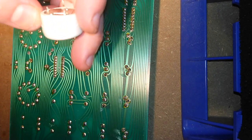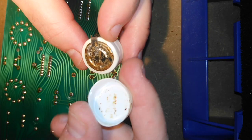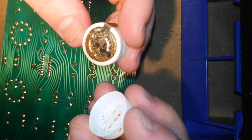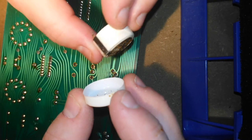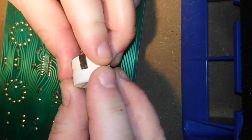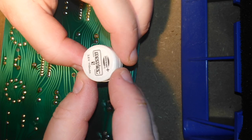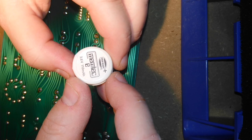Let's remove the plastic cap. Here we can see that the plastic covering this battery has prevented any leaking battery acid from getting onto the circuit board, which is a good thing. That said, you should replace your battery as soon as possible on your Oscar. There are reports that the reset circuitry sometimes tries to start the processor before the voltage has stabilized, which means that even with a new battery it won't boot — or at least not regularly. In that case consult with a professional, as you probably need to pull separate power cables to the processor board.